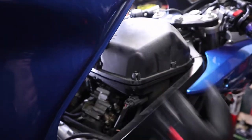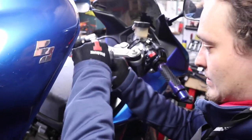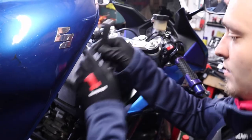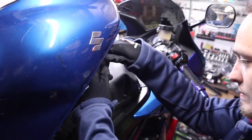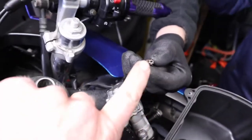So that's the new ignition switch replacement. We remove the airbox again so that we can have a clear view at the connector for the ignition key switch. We think that if you want to remove the ignition housing you're going to have to remove the top bracket. The workspace is a little too small in here — we've got a little anti-theft Torx bit with a hole in it for this.